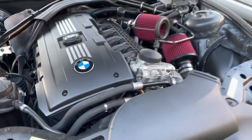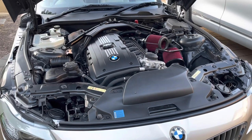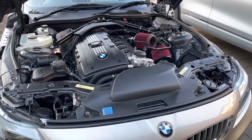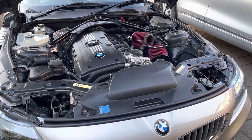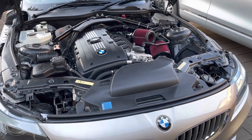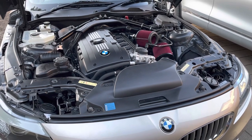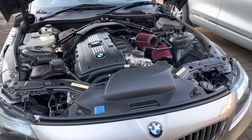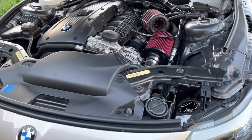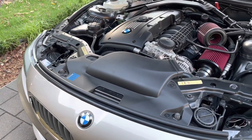I've researched it and found that it is a known issue with these BMW E89s, also with the E85, the earlier generation, and some of the 5 series from the same era. I was aware that Mercedes had this problem in the mid 90s and late 90s from using biodegradable plastics, trying to save the earth. I'm not sure what BMW is trying to achieve, but it is a known issue with these. And the general consensus is that it's caused from heat generated by the halogen globes themselves. And so now I've upgraded to LED, I'm confident that that right one won't get any worse, or it shouldn't degrade.